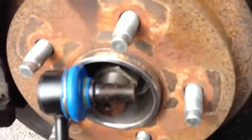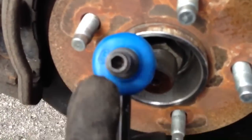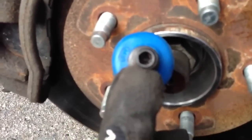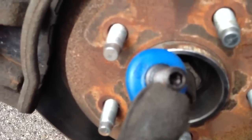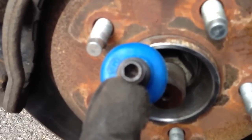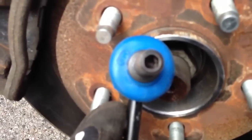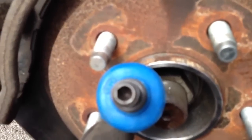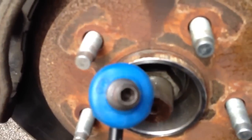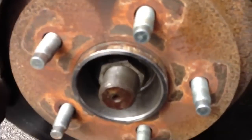However, this is kind of neat and I just noticed — I don't know if you can see this on the video, but inside there's a Torx socket, so you can use your 17mm wrench — at least what this one takes — and a Torx socket or screwdriver or Allen wrench to hold the stud from spinning. I'll have to grab one of those if I go to tighten this one up. I thought that was pretty neat, so I'd add that in too.